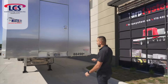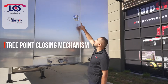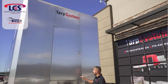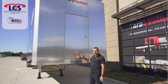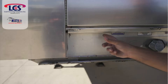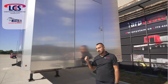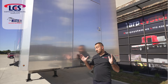Number one, we're going to start with the door in the front. This has got a three-point closing mechanism at the bottom, in the middle, at the top. It's a pretty sturdy door — you can see it's not flimsy, it's good quality. Another good thing that Load Covering Solution does is they mount the bulkhead about four inches in the front of the trailer. This helps you get a little more room inside and also helps the space between the truck and the trailer to be minimal.